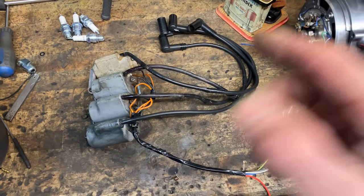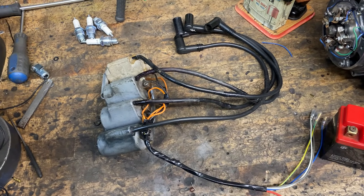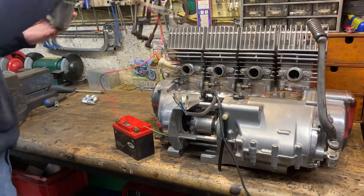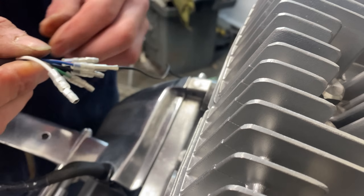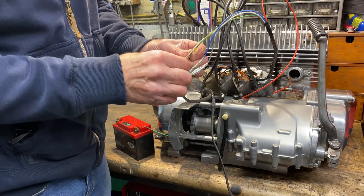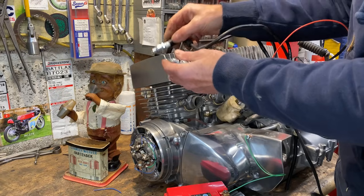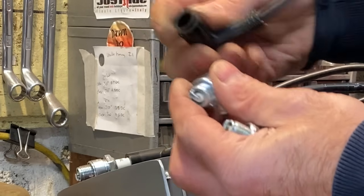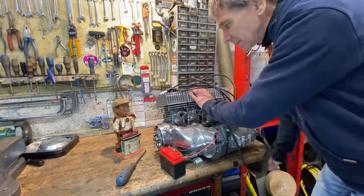With the timing complete, I can now use four ignition coils to connect up to the points to see if it sparks. I rest the coils on the back of the engine for now — I'll make a bracket up later — then connect up to the four wires that go down to the contact breaker points, and a positive and negative wire to the battery. I then remove the four spark plugs, connect them up to the spark plug caps and kick the engine over to watch the sparks. And they were perfect — really big sparks. I was well pleased with that.